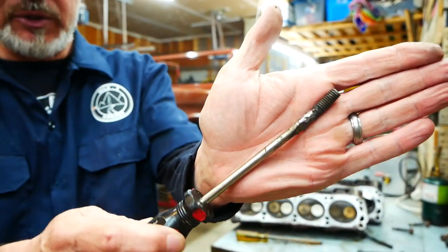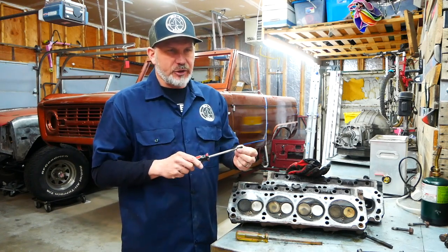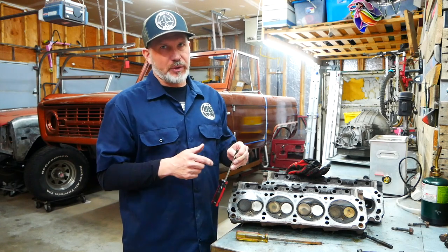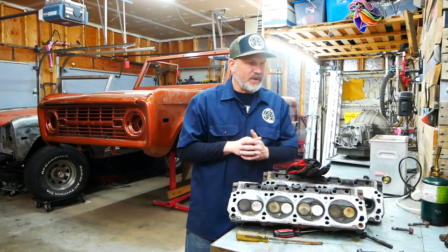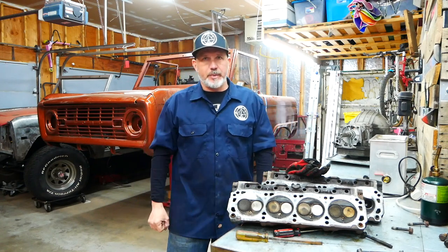I think when I had welded the first one and tried to turn it without doing the rest of the steps, the bolt literally just broke off right where the weld was. So we decided to soak the bolts and shock the bolts first, and then we got them out relatively easily — that was actually the trick. The screwdriver weld was just the means to getting it out. So try that on your next Ford head or any head you need to get intake bolts out of, and maybe you'll have success with it. If you haven't already subscribed, think about it — it's a fun little shop, kind of like hanging out with your friend next door and his projects, only you don't have to invest your money in it, just a little bit of time. That's a wrap for My Point 3 Garage. We're about to rebuild the transmission, so stick with us for the next episode.